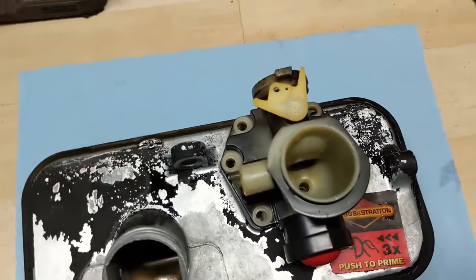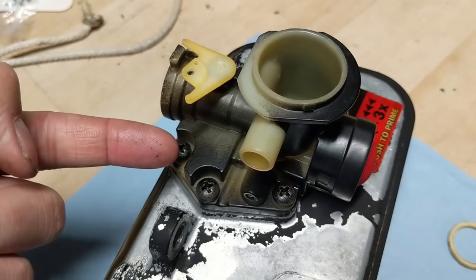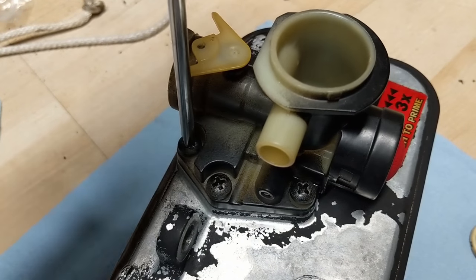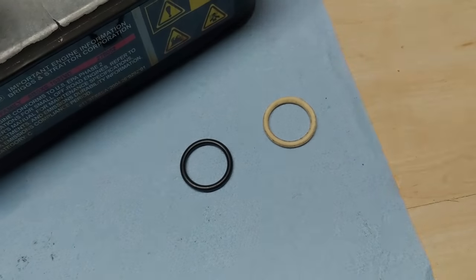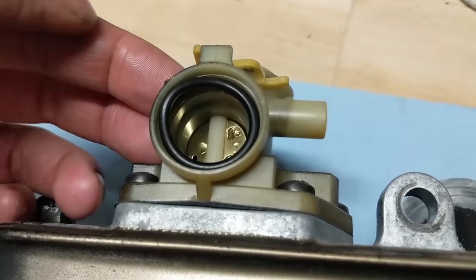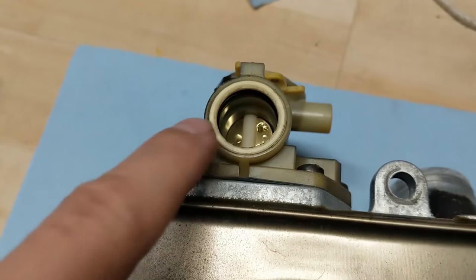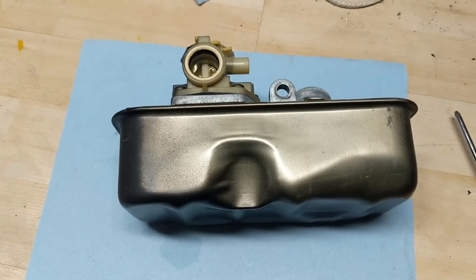I'm going to take our diaphragm fuel pump spring here and simply pop that back on. I also went ahead and cleaned out our little pickup screen so we're going to take that and put it back on top of the carburetor. Now we're ready to drop the carburetor into place, then go ahead and get our Phillips screws back in. When you're putting your screws back in I would recommend just starting them all out first and going slow — because the spring is on the carburetor, when you press it down sometimes the diaphragm can pull itself and misalign your holes, so you want to make sure you don't tear a gasket or your diaphragm. Get all your holes lined up first, tighten up all the screws, then go ahead and get the o-ring and the o-ring retainer in place. Take the o-ring and just pop it in — it's going to have a little groove it sits into — then take your retainer and you should hear it click when it pops in. The retainer is what helps keep that nice tight fit up against your intake manifold.